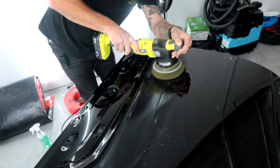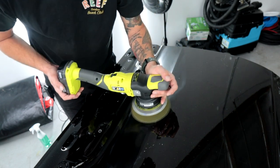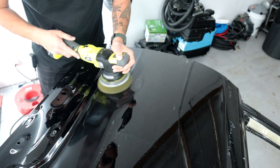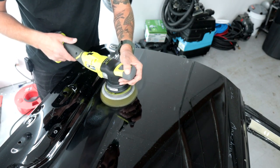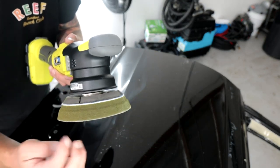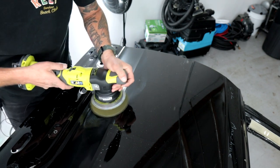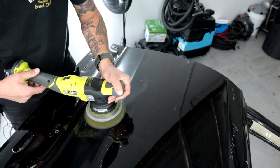Taking it down to about 5,000 and just letting it sit there. This doesn't feel like 5,000 to me when comparing it to the MaxShine. Let's go ahead and test if I can bog it down — usually on a hard edge it'll bog. Yeah, it completely stopped on that hard edge. I put some marks about a quarter of the way around so you guys can see. When you bog it, the marks are just sitting there slowly — that means it's not doing its job. If it's not rotating, it's not correcting. So we're going to have to bump it up. We can still get it to bog, but it's pretty difficult to do.